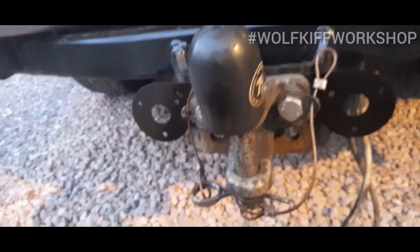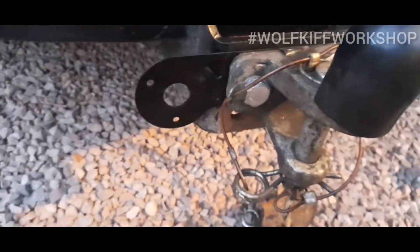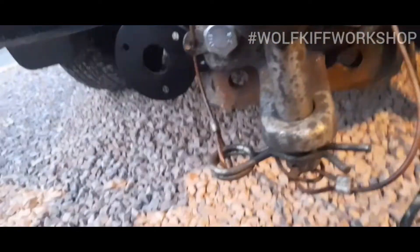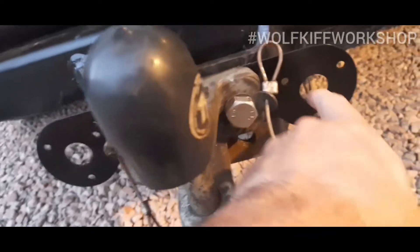What I've done is fitted the more agricultural, heavy-duty tow ball, but I've actually fitted it a pin further up so it will be higher when I'm towing something. I'm going to have to try it out with my trailer just to see if it makes a difference. This is definitely a more heavy-duty tow ball and I've bolted it in straight where it is so that's nice and tight. One thing I quite like is it's got these little pins — linch pins with a clip — to hold the main pin in, so even if you pull them off you're never going to lose any of it, which is really cool.